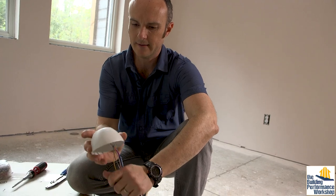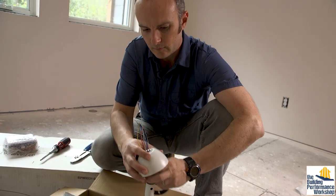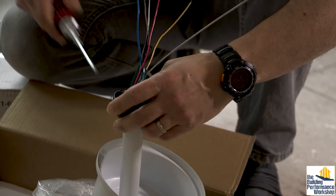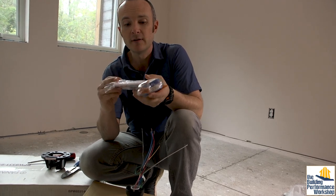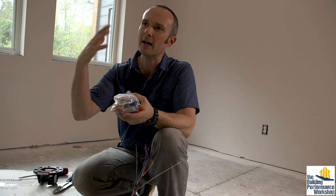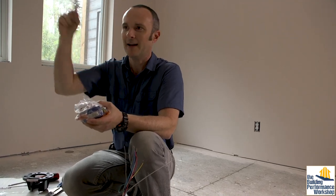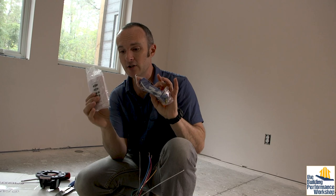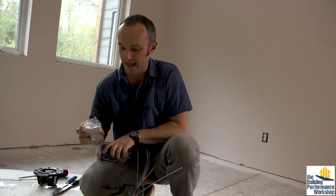This piece goes down to cover the stuff on the actual fan motor. This is the remote control — you've got a switch that's going to turn the fan on and off, but all the fine tuning, where a normal off-the-shelf fan would have two silly pull chains that get wrapped up around the fan, this is a wireless control. The wireless communicates with this receiver, and before you forget and install it, you need to tune them to the same frequency.